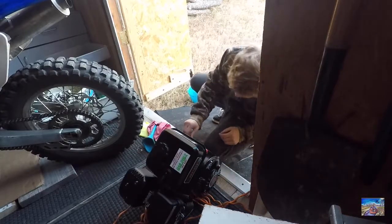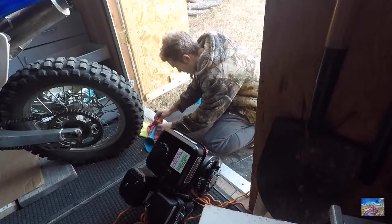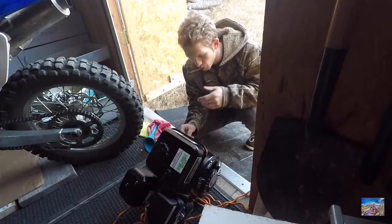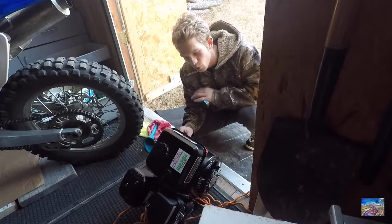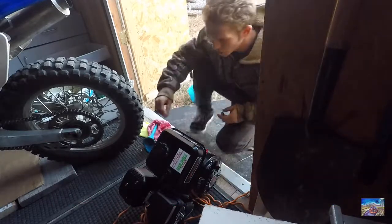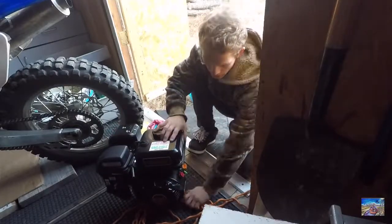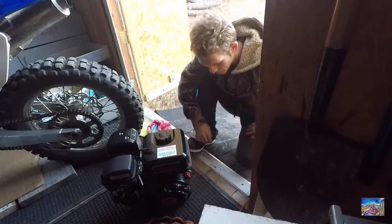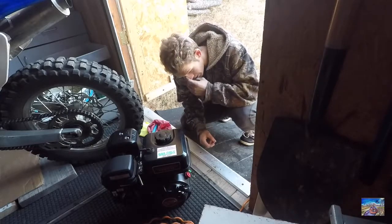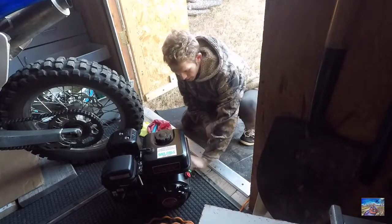Let's check it out. Let's close this back up - actually, we're gonna want to wipe the dipstick first, make sure it's all dry from any oil. Anytime you get any engine like this - this is a Predator 212 - I would most definitely recommend flushing the old oil in there. There's very little on the bottom, just so the engine doesn't seize up. You never want to add new oil into the old; you want to do a clean flush and put brand new oil in there. You can look at your manual, or I just looked it up on YouTube and Google and they said 10w30 works great with them.